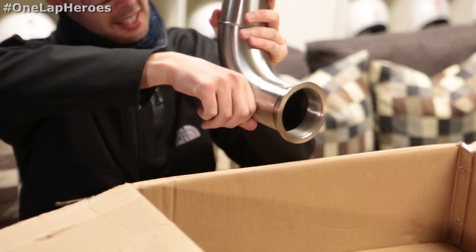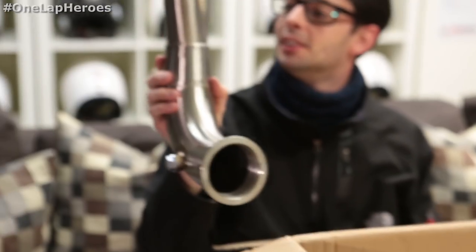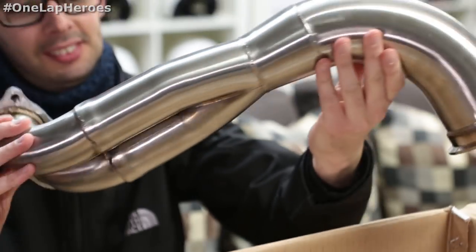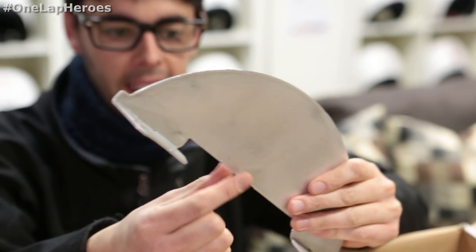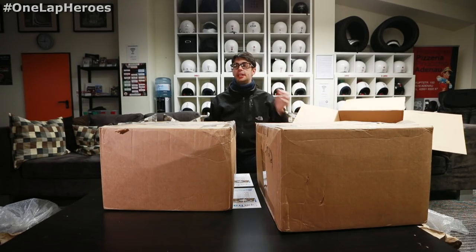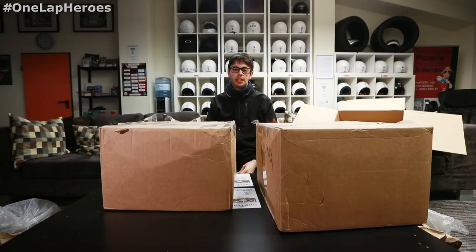We want the plug here. The quality is really where it has to be. I see a heat shield, aluminum, custom — probably because the clearance with the subframe doesn't allow to use the original part. Gaskets, everything — all the hardware needed to put everything together. Something that doesn't come with the kit is the full exhaust — that has to be made custom when everything is ready and the car is running. I have to take it to an exhaust shop and make a full custom exhaust. So the kit actually stops at the downpipe.